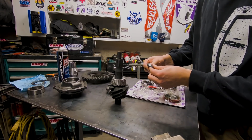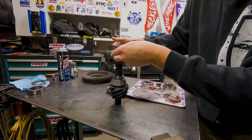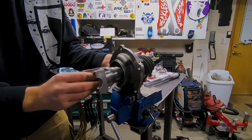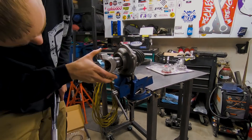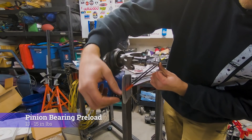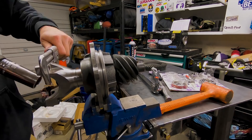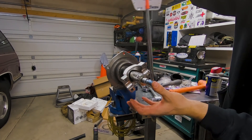After you press the inner bearing onto the pinion shaft, put the solid spacer and shims onto the pinion, followed by the pinion support and outer bearing. The shim stack sets the pinion bearing preload — essentially how tight the bearings are against their races. Do not install the pinion seal until after the pinion bearing preload is set. While torquing the pinion nut to 200 foot-pounds, rotate the pinion to make sure it is not binding up. Once torqued, check the force it takes to spin the pinion with an inch-pound torque wrench. Preload should be between 13 to 15 inch-pounds. My initial preload was too low at 4 inch-pounds, so I took it apart, reduced the shim stack height, and re-measured. After adjusting a couple times, I got the preload dialed in at 14 inch-pounds.